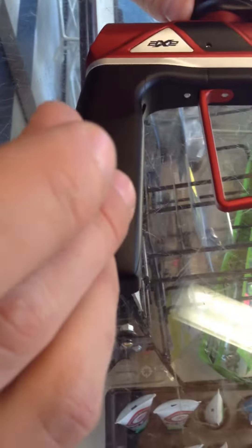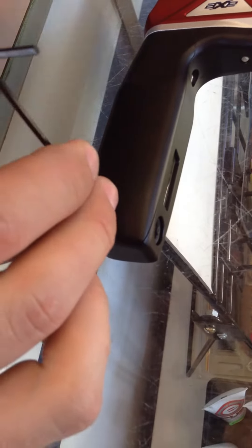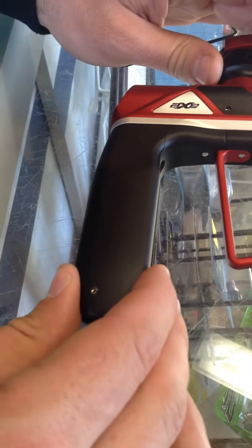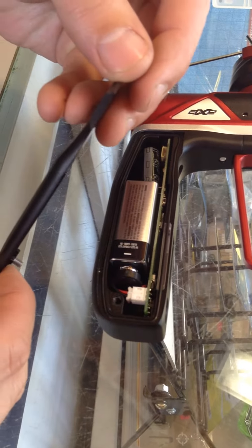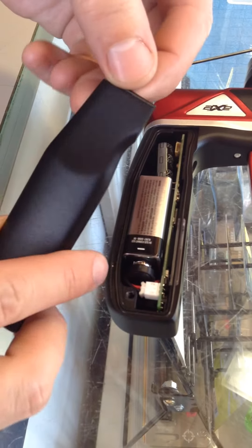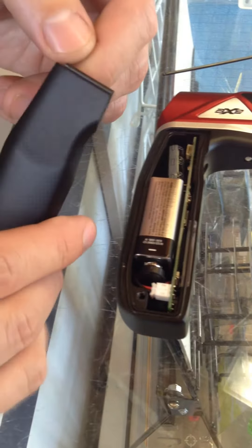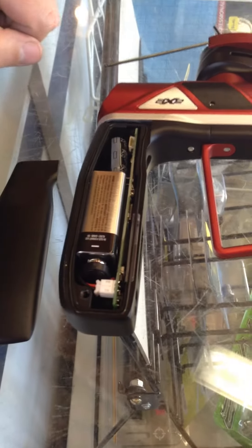The first thing you're going to do is take off this cover here on the side. Your Allen wrench is found in your tool kit that comes with the Axe Pro. Turn it counterclockwise, usually about three to four revolutions, and that should get the screw out of there. Then you're just going to gently grab this cover and wiggle it so it comes off. It does have a flange, so you don't want to try and pry up on that flange because you're going to start bending up your gasket and possibly ruin your cover if you twist it.